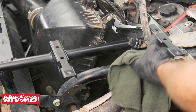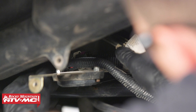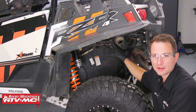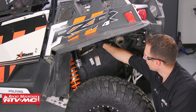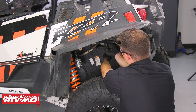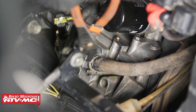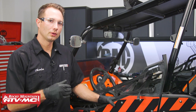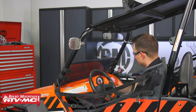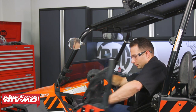I'm going to use a little silicone on the IAC hose and install it onto the air box. After that we can reinstall our cargo bed and reconnect our tail lights. Once you have all your wires routed — for these tail lights we ran the wires down the back side of the bumper — and once all the electrical connections are made, go ahead and tie down the wiring harness using some zip ties. Next we'll hook up this breather hose for the crankcase vent. Now we're ready to reconnect the negative cable on the battery. At this point we need to finish bleeding the cooling system — start the engine in a well-ventilated area and let the fan cycle for two cycles.